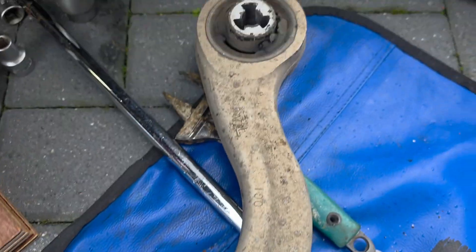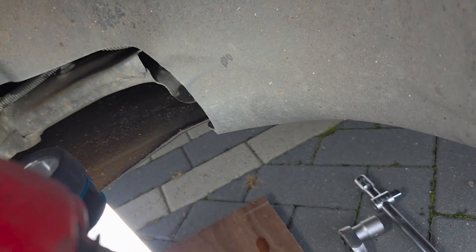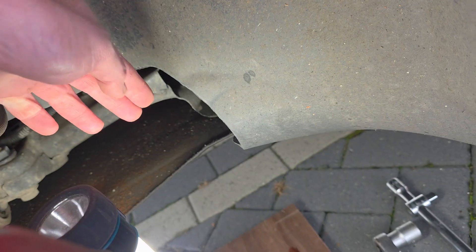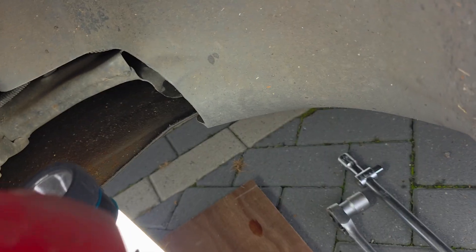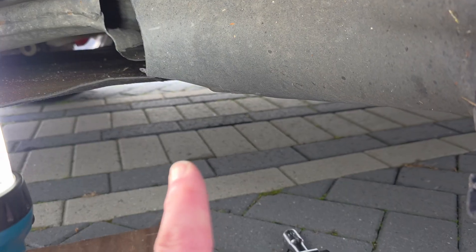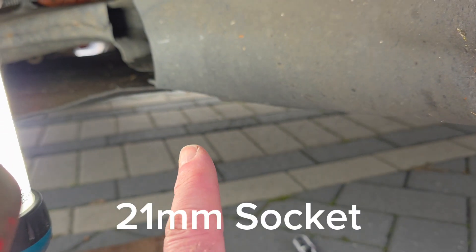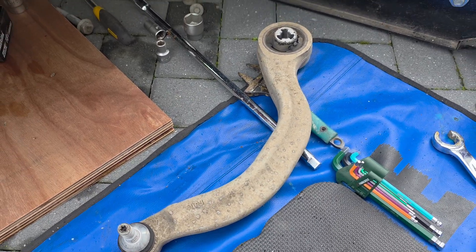This part has done 122,000 miles. As you can see in the video, it's quite easy to come out - you've got to pull it around this way and then manipulate the plastic covers to get it out. In between there is a nut on top, so you undo the nut from underneath, which is 21mm, and once it's loosened just hold the nut on top with your hand and loosen off the rest. It wasn't too hard to get that out.